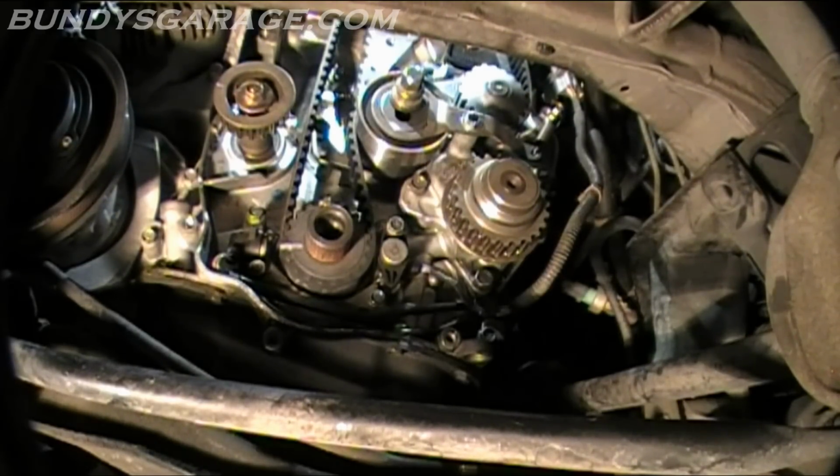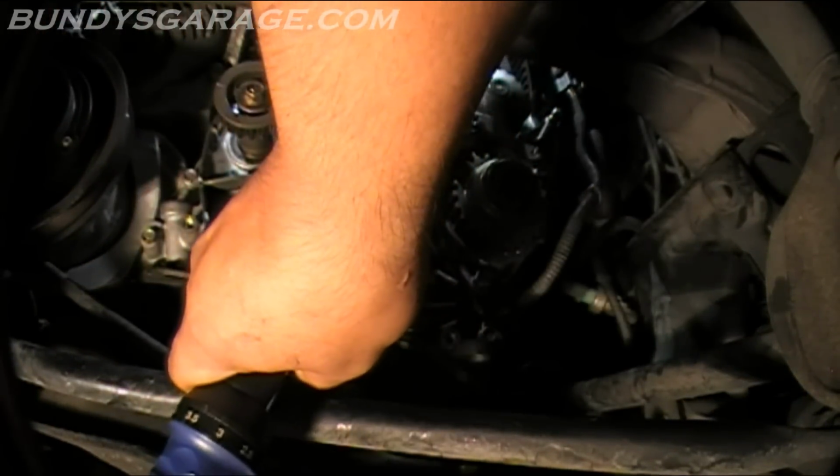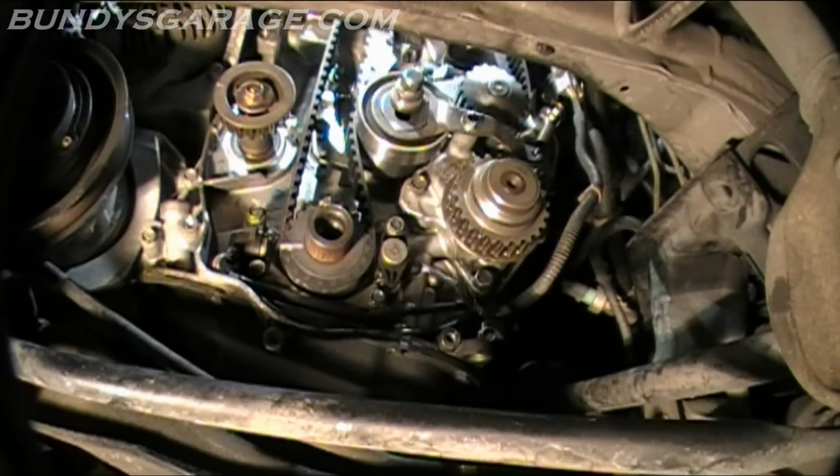Now it says to torque down the adjusting nut to 33 foot-pounds. Torque wrenches to 33 foot-pounds. Find my 14 millimeter socket. Okay, it's supporting it. Let's see if I can get in there this way. I highly doubt it. Oh man, I can't get in there. Tighten it up by hand. I'm not going to do it super tight. Get it down there. Snug up. Okay.